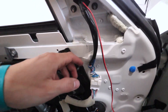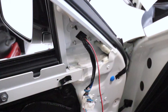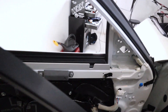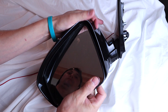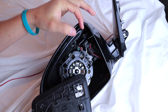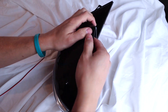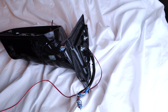Here we are revisiting everything — wires hanging out. We're gonna take out these 10mm bolts, pop this clip out, and remove the whole assembly. We'll pull the whole assembly out and take it inside. First thing you're gonna want to do is push up the mirror glass — it should be unclipped. The really light silver-gray one is on the inside, black one is on the outside.